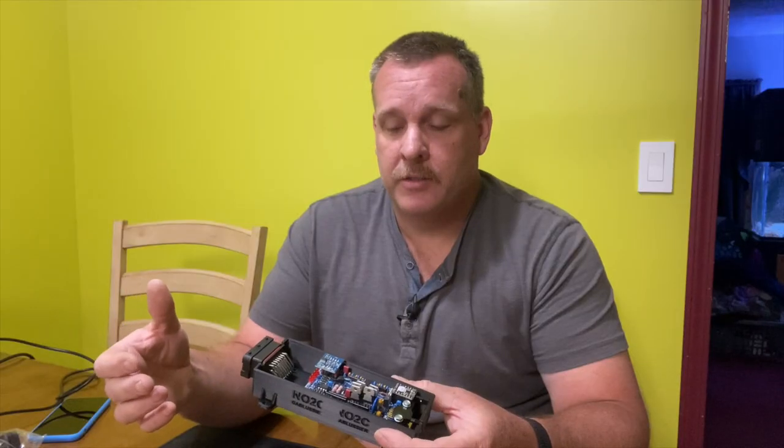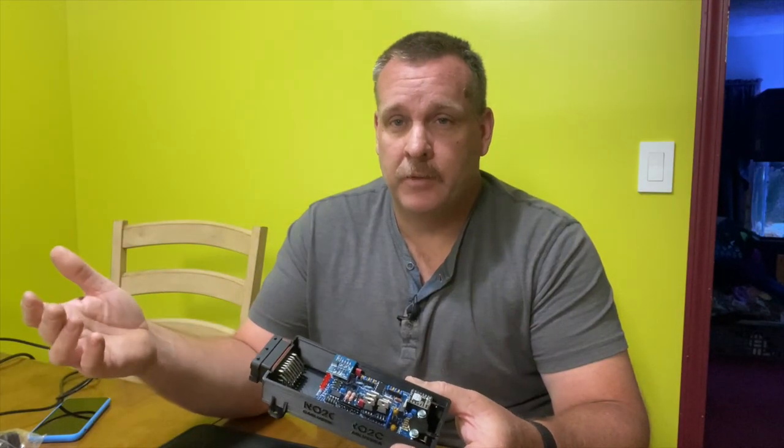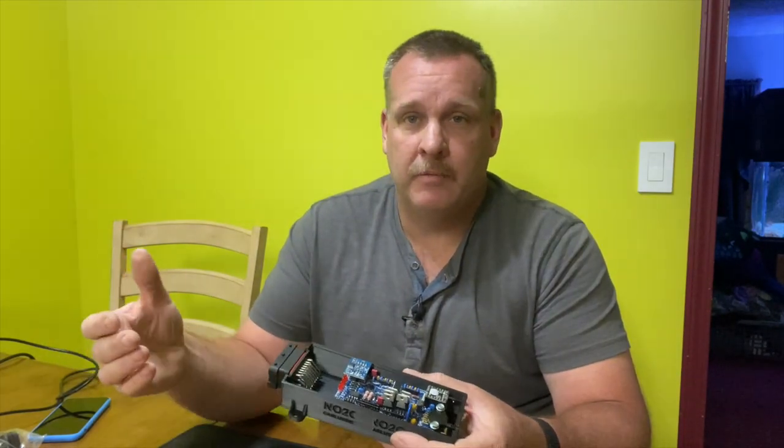Let me know if you have any questions — hopefully this is helpful. I'm going to keep moving down the line with the rest of the build. Hopefully you're interested in something like this. I was going to try and do videos on the whole process: how I mounted things like crank sensors, how I mounted the injectors on this engine. I converted the carburetor we had to just a throttle body and added a throttle position sensor. Hopefully as this goes along, it's useful. Thanks.